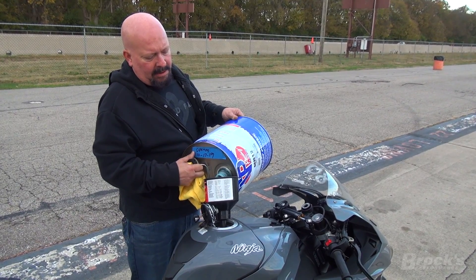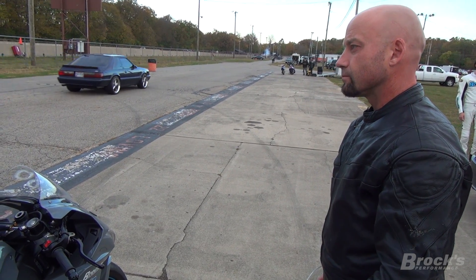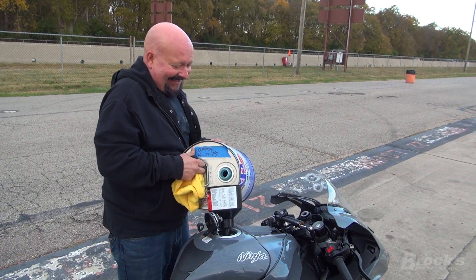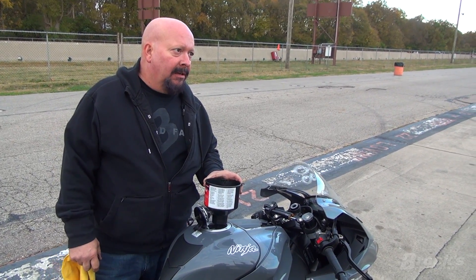I want to run it just to see what it does, but I think I'm going to have to go back to that 15-37. It might work out better for me. It's just going to be interesting to see what it does at the top of first. It's got a lot of power, it's going to come up, and that's what I'm trying to combat. It may be a little rough to get rolling — maybe second too — or make up for it on the big end.